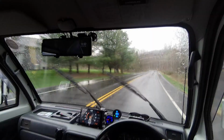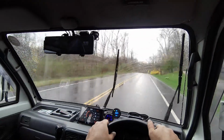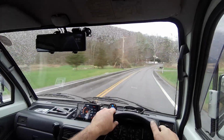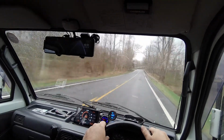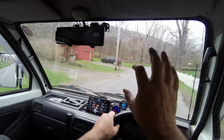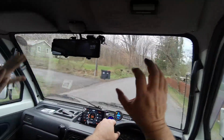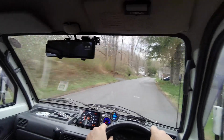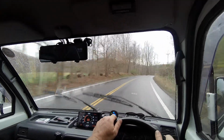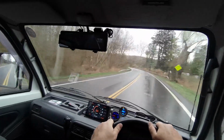Under a load, I would almost feel like, yeah, I need new wipers. That's still there, hear it? And when you give it a little gas, it goes away. Gotta be that U-joint. It's weird, right? Yeah. Didn't do it until I put the lift in. That U-joint has like a little bit of resistance. You feel it? Yeah. So it has to be just binding up a little bit, and it's making that vibration. Since it's on more of an angle now? Yeah, it's more of an angle with the lift, right. So as soon as you get up and you let off a little bit, it goes away. If I let off, we're just like... Yeah, I'm convinced it's U-joints.